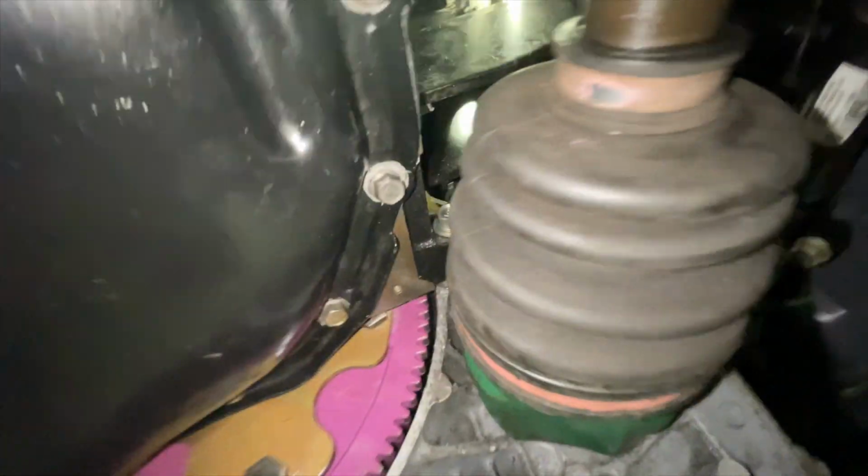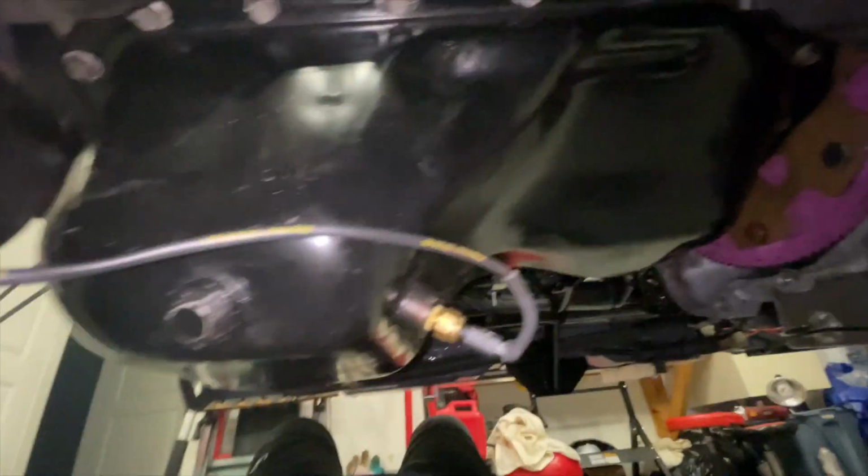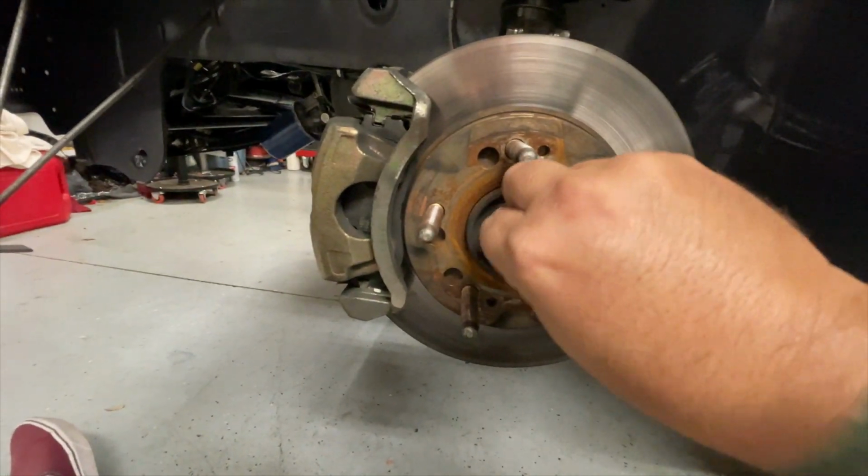Has to be a dowel on this side too, that you can't really quite see from this angle, but it goes right here. Dowel, dowel. Put this bolt in. Don't over torque it. This is aluminum. Converter bolts in. Tricky rear transmission bolt in. Axles in. And lower ball joints bolted back up. Just gotta throw on these axle nuts.